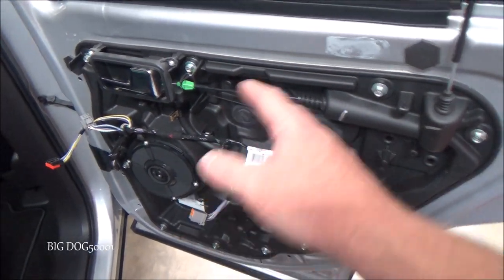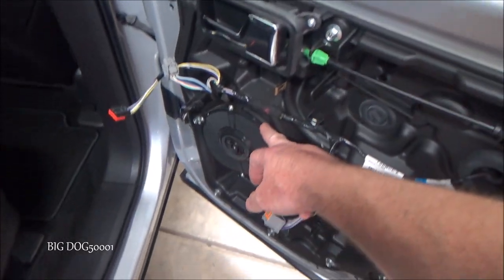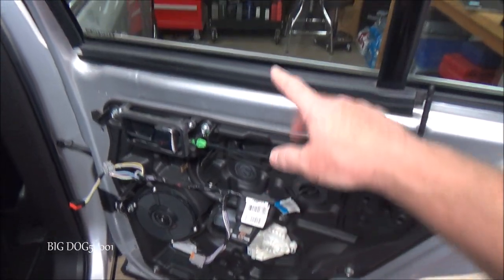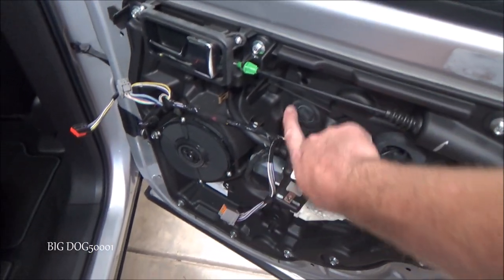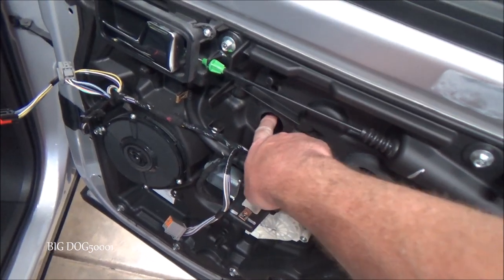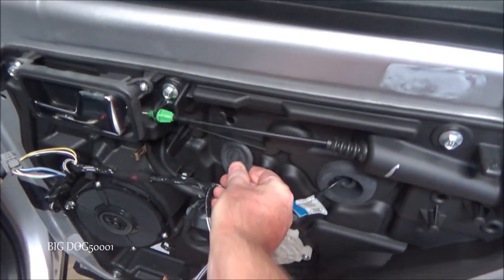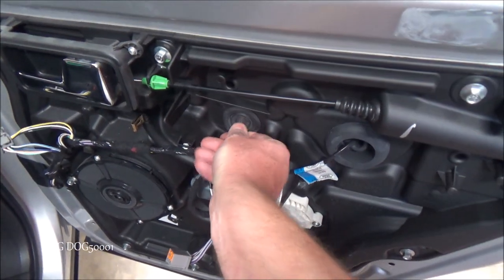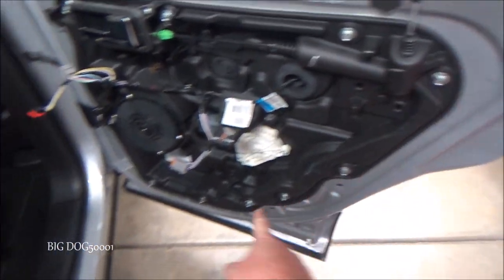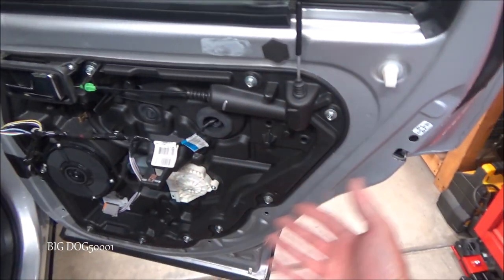There you can see what it looks like with the door panel removed. Now you have access to the door handle, door cable in case you're having any issues with it, the speaker, the wiring, and the window motor. If you need to get further in, generally we're going to lower the window, pull this little plug off, and lower the window until we can see the bolt that holds the window on. Take it off, then put the window up and tape it or use some other device to hold it up, then put that back in. You've got a whole series of bolts all the way around to pull off, and often you need to disconnect the wiring to get that off — and that gives you access to your latch and other stuff behind there.